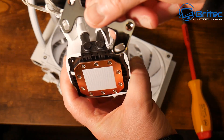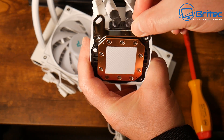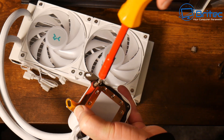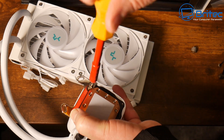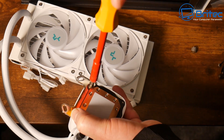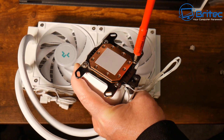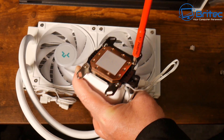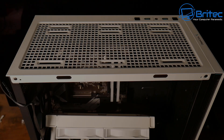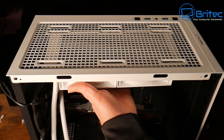Remove the plastic cover protecting the pre-applied thermal compound. Because this is AMD, I just need the AMD bracket — it goes into position and screws on with four screws, two on each side. I've already put the mounting screws onto the motherboard, so I can push the pump head into position and tighten it down.